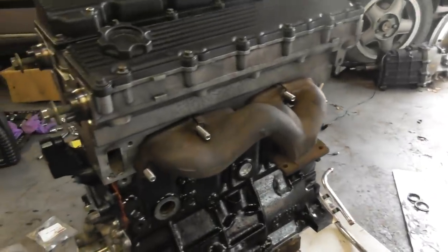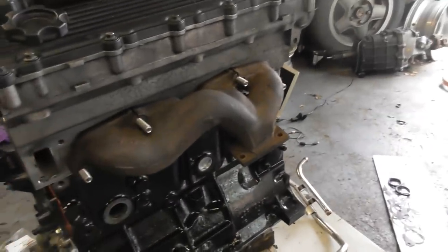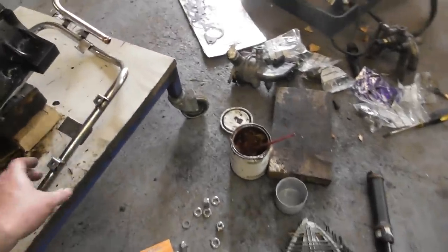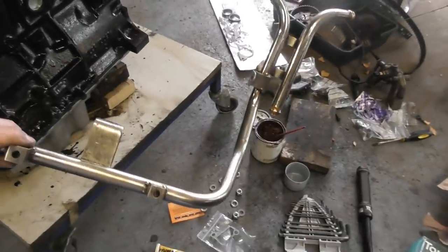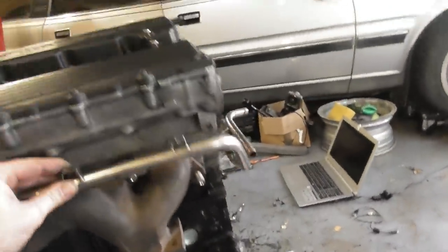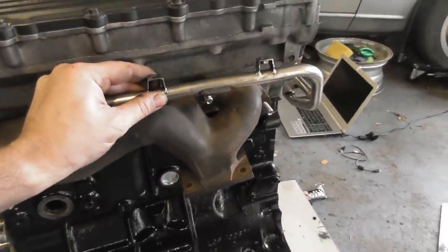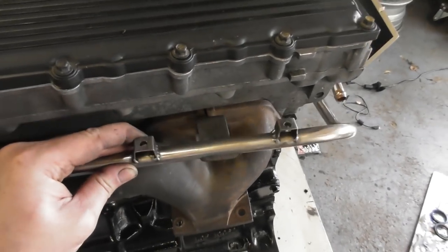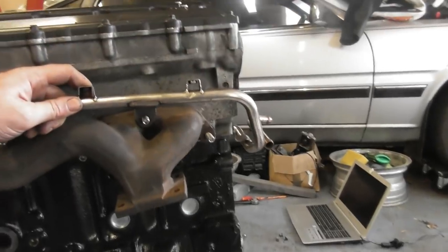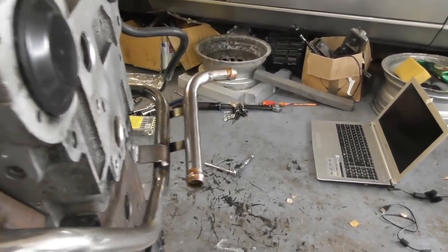It appears it doesn't much matter what order things go on. I did want to offer up the manifold first, because sometimes when stuff gets helicoiled it's not actually straight, and you might have to wind the studs in after the manifold's up. I've also put copper slip on the stainless going into the alloy head, so hopefully they're not a nightmare to get out in future. This is a very nice thing to have — stainless steel water rails. They took me ages to find, but on that Rover 420 GSI tourer I had, I had to weld repair the originals. They're a notorious rot spot, so having stainless ones means I should never have an issue.